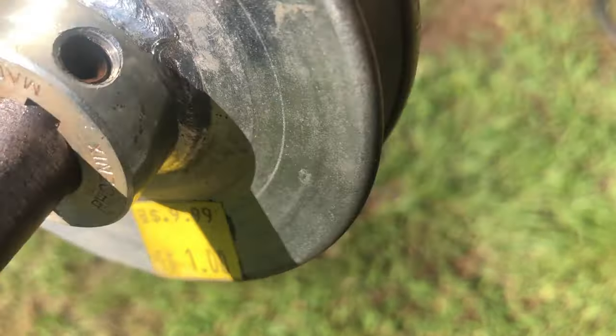So here with the Cub Cadet, here is a throttle that I want to put on it. I just took two bolts out, took the air filter off. That loosens the carb air. If you lean it just the right way, you can unhook the governor. Here's the old governor rod. Now we're going to hook the throttle straight to this butterfly. So the old throttle handle, it was cuter, but it's all rusted up. That's no good. I've got the new one installed. It flows really good. We just have to now hook up the other end.